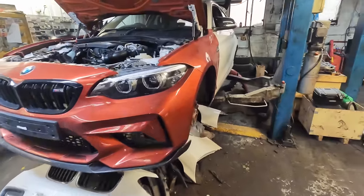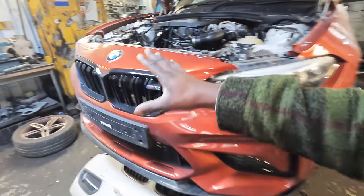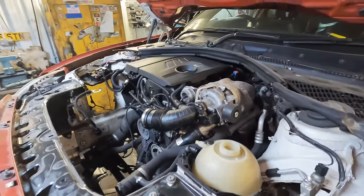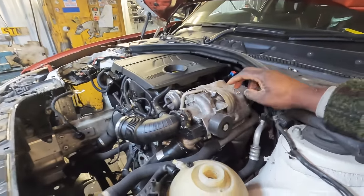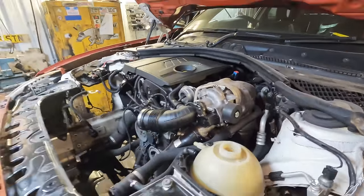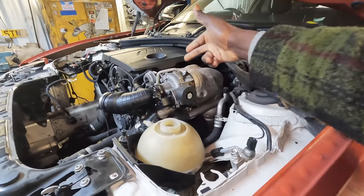But for now, what I'm gonna do is remove the bumper again, all the lights and that front panel, all of that needs to come off, and I'm just gonna start to prep to drop this engine. I think it's a 1.4, 1.6 turbo engine. It's actually running, it's blowing a bit, there's a slight misfire, but we can still sell that, make some money